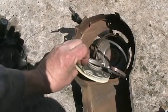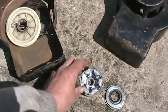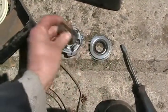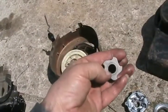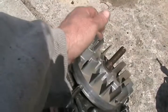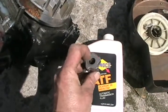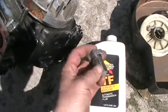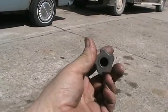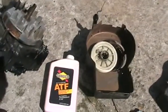Eventually it may seize up enough and actually grab the whole thing and damage everything. The solution: you don't even have to spin off the tight thing that holds the flywheel down. Just use an ordinary screwdriver, pop off the cap, and the part lifts right off. Stick some steel wool inside there, clean up the hole, then take some sandpaper finer than 120 grit and sand the area nice and smooth. Then dump about 10 drops of automatic transmission fluid down the hole so it gets on the little felt pad. Put some on your finger and wipe it on the shaft. Don't use engine oil — it doesn't last as long, will gum up sooner, and cause it to seize again. ATF is the best stuff.